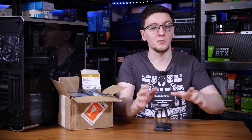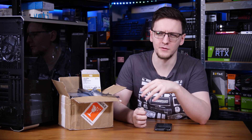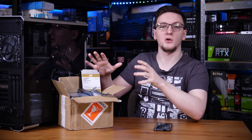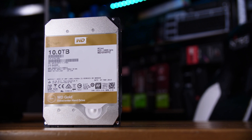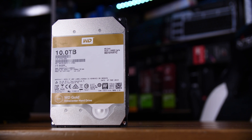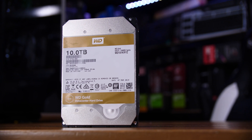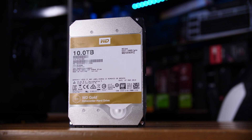To solve all of those problems — and not quite because of a space limitation just yet, but for room to grow especially now I'm running two channels — I thought this would be a good time to do a bit of an overkill upgrade. I went and bought six WD 10-terabyte Gold drives, a total of 60 terabytes raw. With two used as parity drives, meaning I can sustain two simultaneous drive failures, I'll have about 35 to 38 terabytes of usable space — a handsome upgrade from the 20 or so terabytes available now.